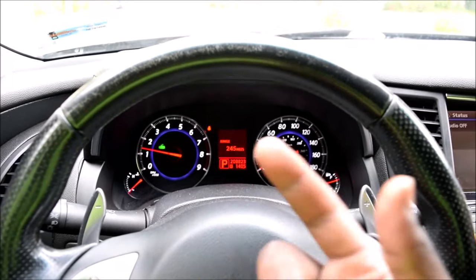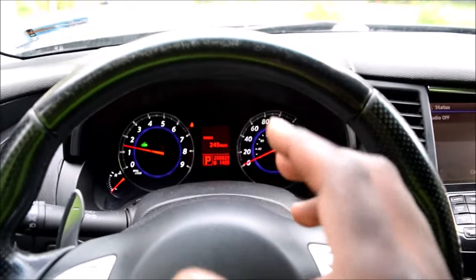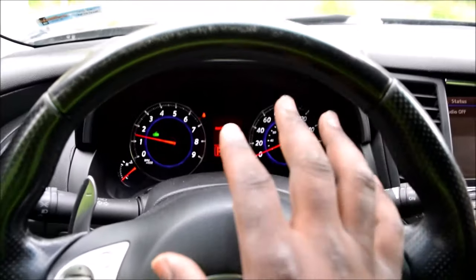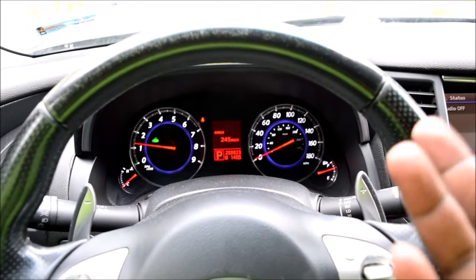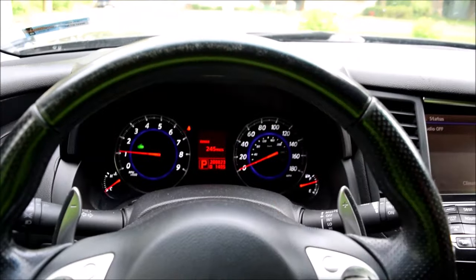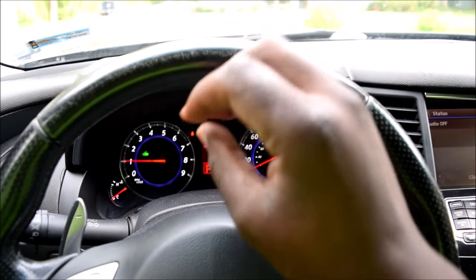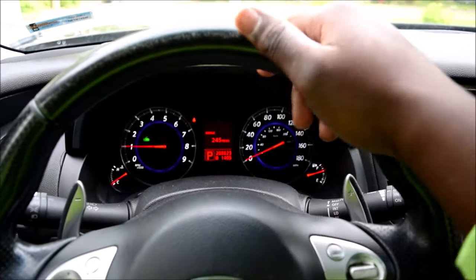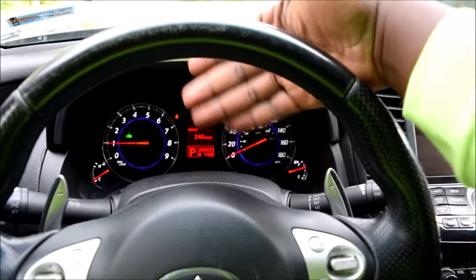Did you hear the sloshing? There's a little sloshing sound going on, and once the car warms up I'll rev the engine so you can hear it. That sloshing sound — if you play your radio constantly with AC making noise, that sound can escape you. What causes it? The sound is caused by air spaces, air bubbles in your cooling system. When you start your car the water pump rushes coolant, and if you have a pipe with air bubbles in it, that's the impact that causes noise — we call it gurgling, burbling, bubbling — and it sounds like it's coming right behind your gauge cluster.